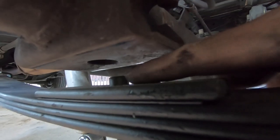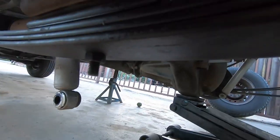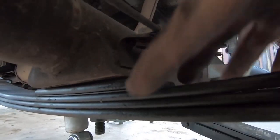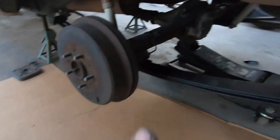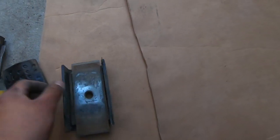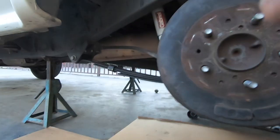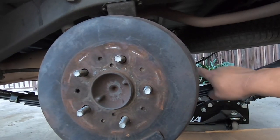One more thing — that hole on your diff should line up with the pin so it falls into place. Lower it a little bit and it should be good to put the U-bolt and bottom plate on. Actually, the pin on the leaf spring is way too small for the diff hole, so we had to remove the pin from the stock springs. Basically these little metal pieces are bent into the leaf spring — you throw the top piece on, the bottom piece on, then bend them in. We got that little piece in; everything is on, we just have to tighten all the bolts and nuts.